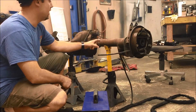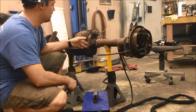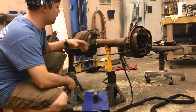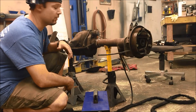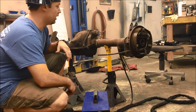What I'm doing is welding the axle tubes to the center of the housing. Sometimes those tubes will twist in there when you start to make power. I'm using an arc welder because it doesn't have to be as clean. If the surface is really dirty, it's just really hard to get clean, and the flux on the arc welding rod helps with that - it makes the rod a lot more tolerant to dirt and grease. That's why I arc welded it.